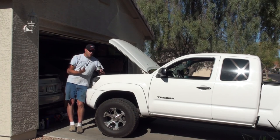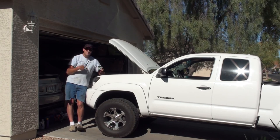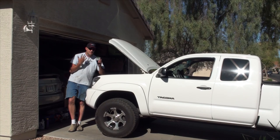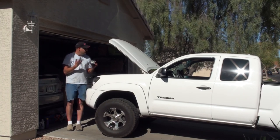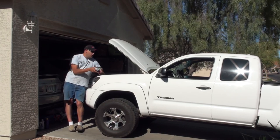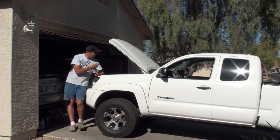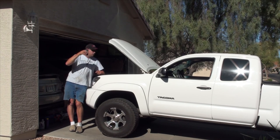You can get the factory Toyota filter — even on Amazon if you don't have a local dealer nearby, and in bulk at a discount. The other reason to go with one of these three is they are the largest filters. The Toyota is the smallest of the three; the Mobil and Napa are pretty much the same size. If you want extra filter capacity for a truck, there's also the advantage that with the longer filter body, this truck has a clutch-driven fan that sucks air right through onto the engine and around the oil filter for a little extra cooling.